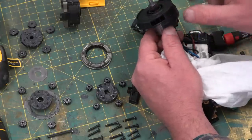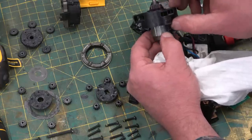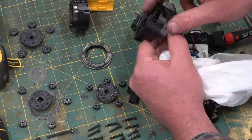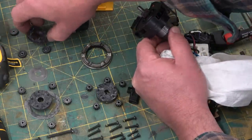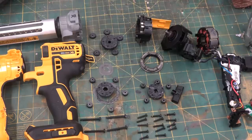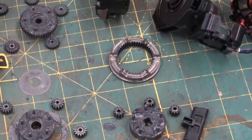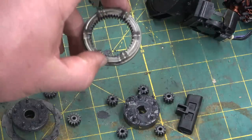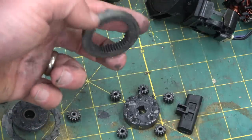Interestingly, the front bearing for this rotor is in this plastic nylon housing — probably 40% glass fiber, something like that. We normally see this in a metallic housing or at the start of the gearbox but not in this case. There's a stub shaft that goes in and it doesn't actually fit tight enough into the planet carrier to hold itself nicely. Speaking of choking a whore, we got a double-ender here doing double duty — this ring gear from the planetary gear set. You can see it's got some indents and raised sections: that's from a hammer drill, in order to put some impetus to and fro in the chuck, but it's got no purpose whatsoever on this tool.